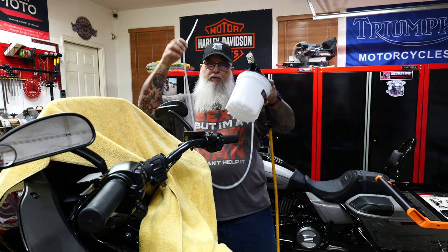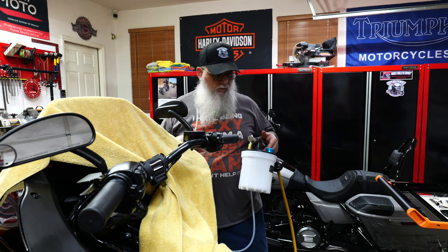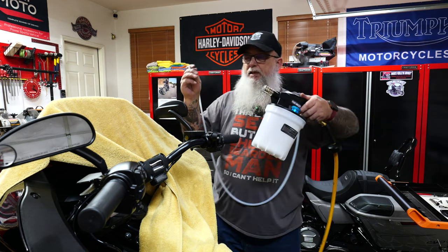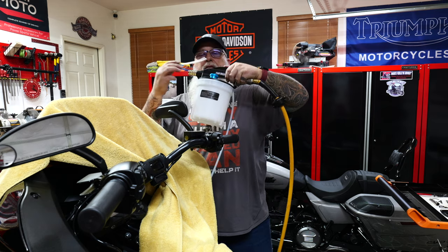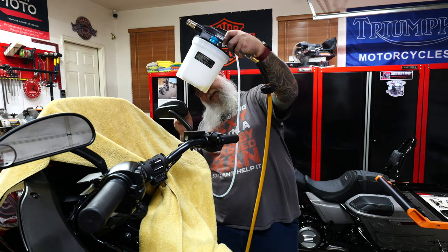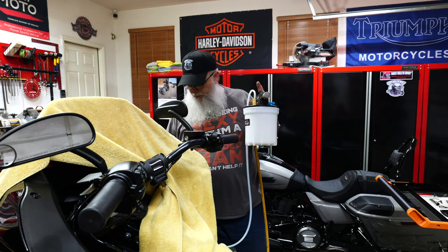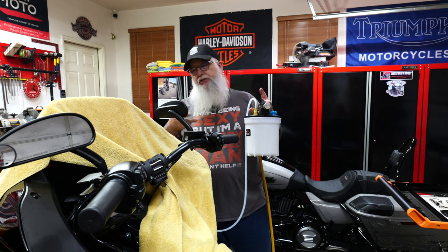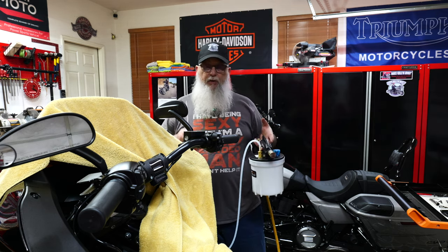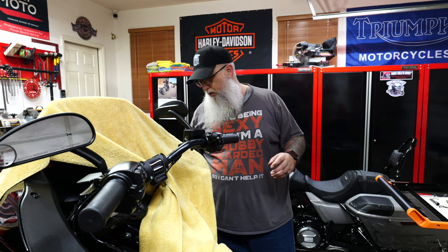You just push it like that and it creates a vacuum and sucks everything out. It's got two different adapters — one with a sucker thing and one that fits over the bleed ports on your rotors. We're going to use this to drain the master cylinder. Get it connected to your air compressor, have the siphon connected, and hit it. Just like that you can see the fluid in the bin — suck this thing bone dry, really good job with that. Then we'll change out the connection by popping this out and do the bleeds on the front calipers as well to minimize brake fluid mess. I'll put this cover back on so nothing gets inside.